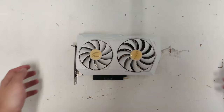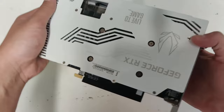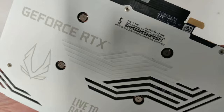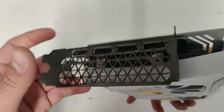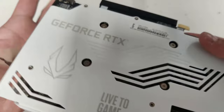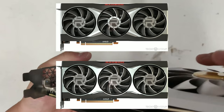As for the most important component in this computer, it is the graphics card. I was able to snatch this RTX 3070 White Zotac card from Facebook Marketplace for $500. You could definitely find cheaper ones nowadays, but because I wanted to keep the all-white aesthetic, I don't really mind paying a little bit more for it, especially when it was delivered to my door. This card is a great solution for gamers that want a high refresh rate gaming experience at 1440p, and it has decent ray tracing performance. The 3060 Ti is also a great choice if you want to save money. Alternatively, if you don't care about ray tracing, you could go with the AMD RX 6800 or 6800 XT, which are more future-proof as they have 16GB of VRAM compared to the 8GB the 3070 has.